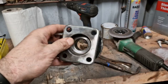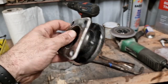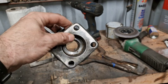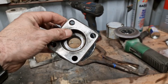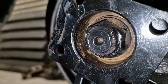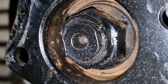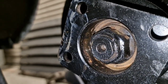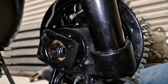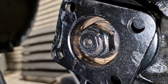So this is the flange connected to the stub axle on the left hand side. I'm going to show you how to take off the one on the right hand side — it's fairly easy once you take a few small steps, otherwise it's a pain. If you look in there you can see the bolt has got a couple of flat faces, so we need to get a dremel in there and weaken them, tap them out, and then undo this bolt. I have no wheel attached so I'll have to lock it down. We'll go in with the dremel first.